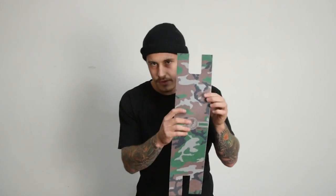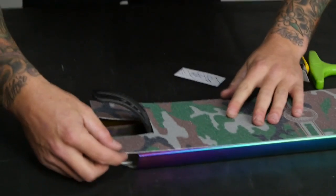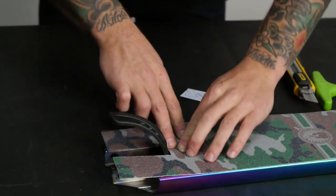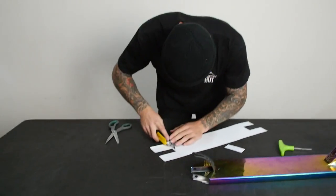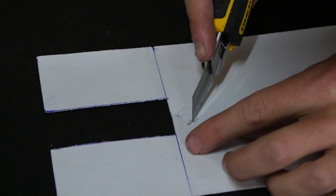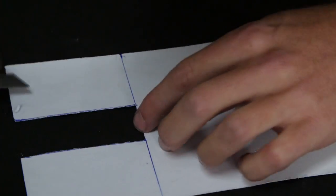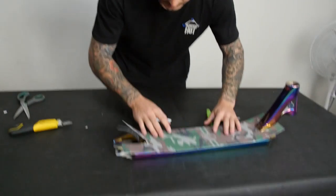We're at the end stage here. We've got the nice cutout. The reason I have the brake bolt on here is because I want to put it on the back and just push around the brake bolt like this, push down nice and hard. As you'll see, it'll leave a nice circle in there for you — that gives you a bit of guidance to cut it out. Get the Stanley knife and cut it around. It doesn't matter too much how you cut this one because the bigger the better — when you tighten your brake bolt it won't get squished. Everything's looking pretty good.